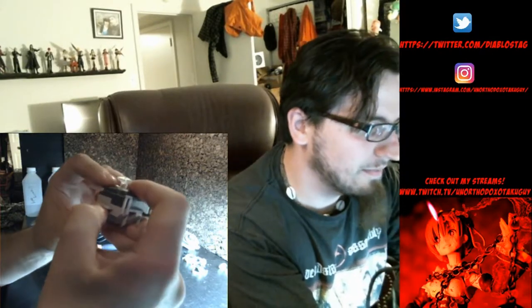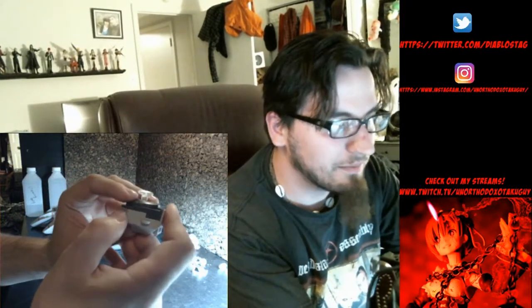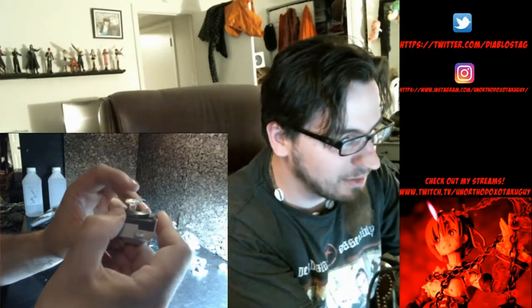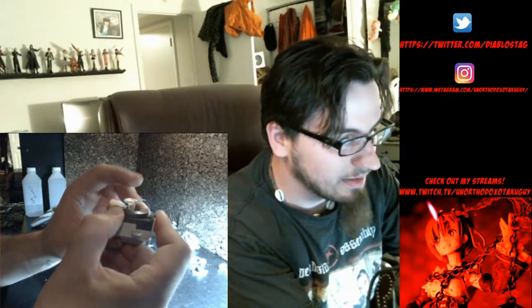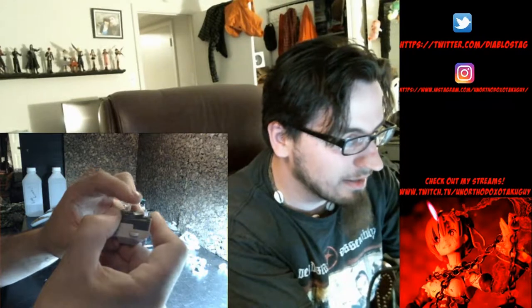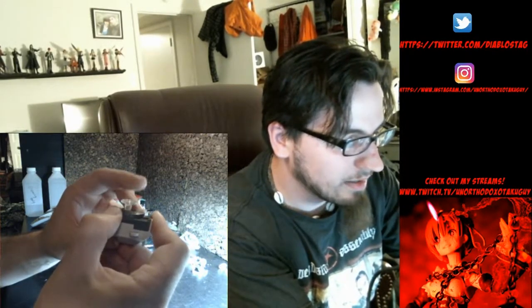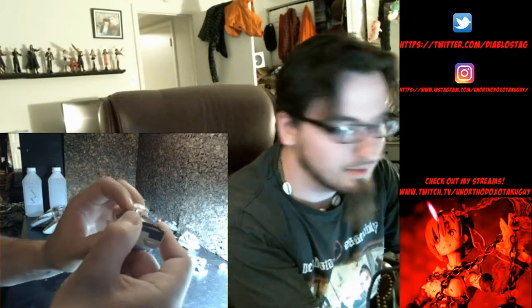There she goes. All right, so now we have it all together. You're going to feel the spring want to fight you. Pinch it to hold it together and rotate the stick and see if it returns to center. Check every direction when you're doing this. If it binds at all, you need to take it apart and file some more. But you see where the control stick is now returning to center. So the spring's working, everything's running smooth in there, and it's returning to center. That means it's all functioning.